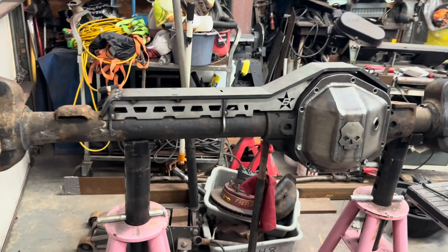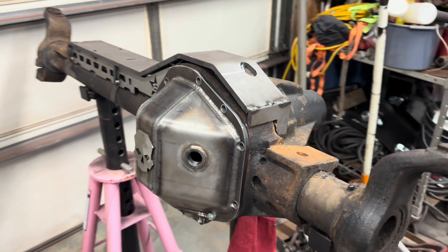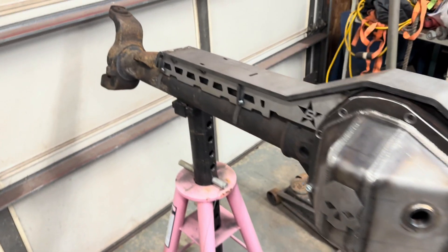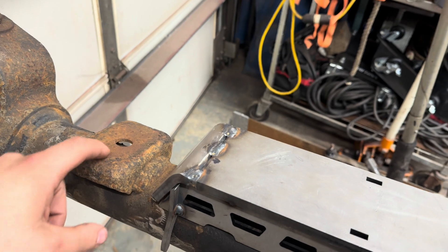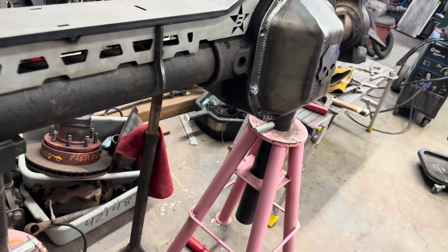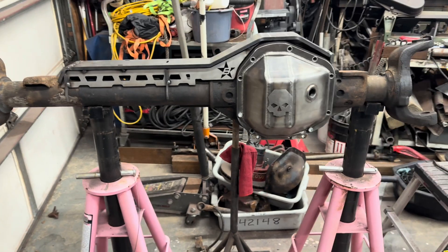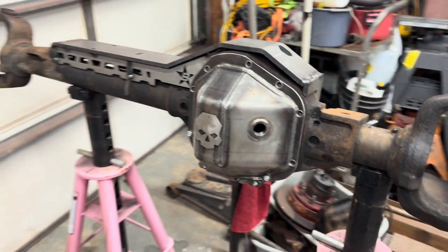So I think that's where I'm going to wrap it up today guys. All I need to do is pull this thing off and weld up the truss, then we'll be going forward with our next steps. I'm going to go replace the spring perch with a machined piece because I don't want to elongate that hole. Maybe in the next video we'll be putting in some kind of slider or skid for my steering. If you guys enjoyed and want to continue to follow along, be sure to subscribe. Have a good one — thanks for watching.